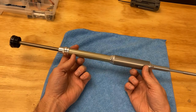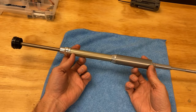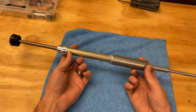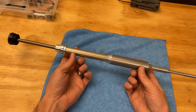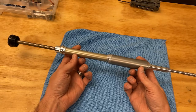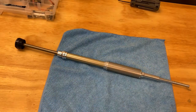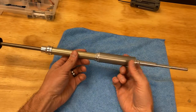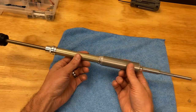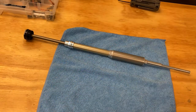What I have here is a specialized damper cartridge out of a 2015 Epic fork. I'm going to take this apart just to show you what's inside. I'm not going to show you how to service the whole thing, but I just wanted to show you what's inside. I've already taken this apart and drained the oil out and released the pressure, so I'm just going to disassemble this. If you try to do this at home, you're going to have oil everywhere, so be careful.